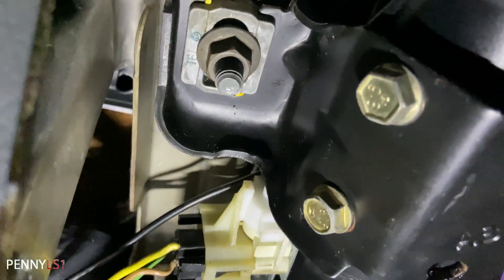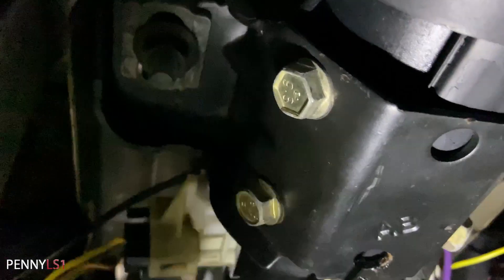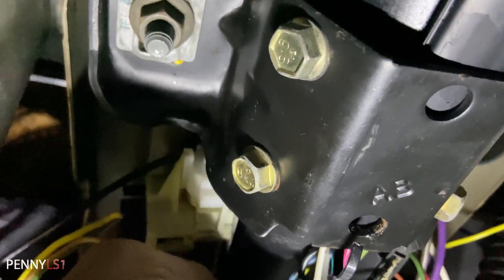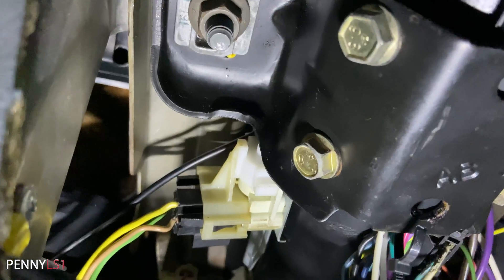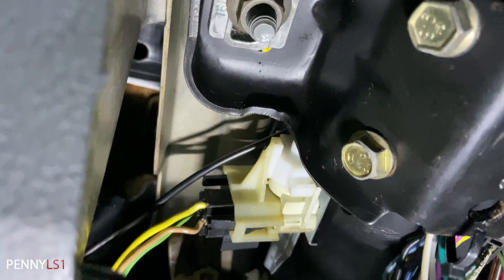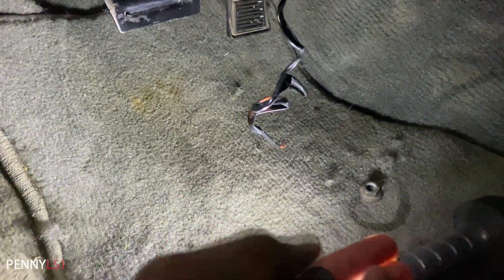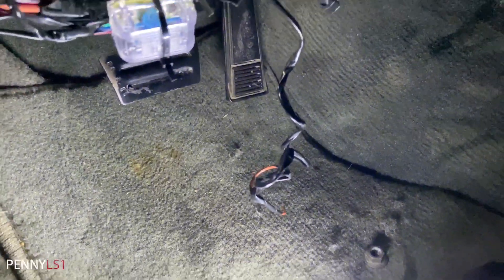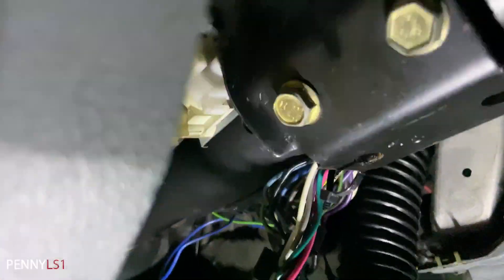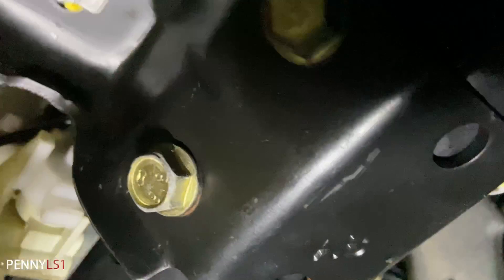The wiring under here is a mess, but I've got to take this bolt down right here and that bolt over there. That way this will drop down and I can get access. I think it screws on — we'll see. Let me go get my wrenches and we'll get that down and swap this switch out. These were 15 millimeter on the two bolts that held the steering column up. Now I've got those two out, and I need to get these four out that hold this bracket onto the column.